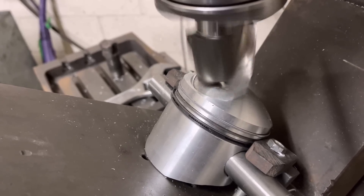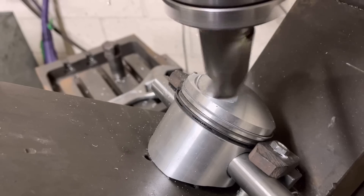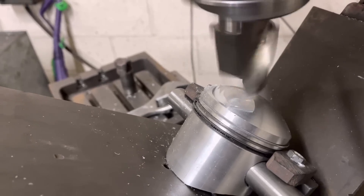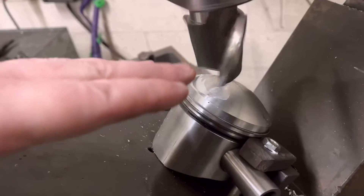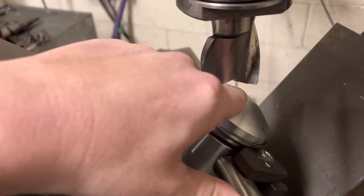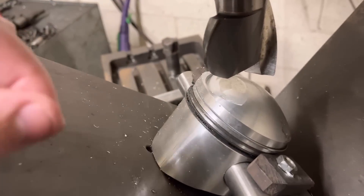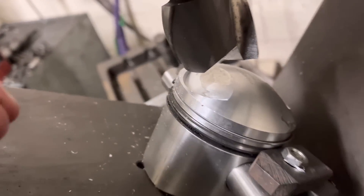Until it just goes down to the level of the existing pocket. What I normally do if I'm just opening up existing pockets, I normally slope the piston very, very slightly that way, so we're not trying to cut the inside of the existing pocket platform, just going right to the outer edge. As you can see there, that's all done. We'll turn it round and then do the other side.